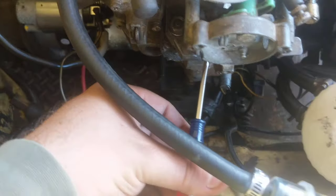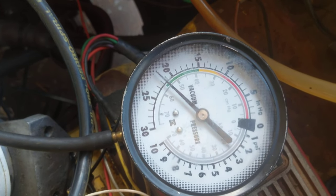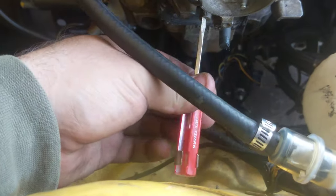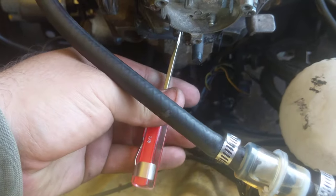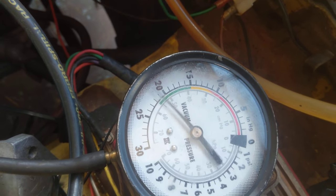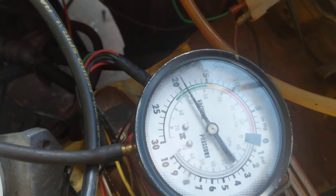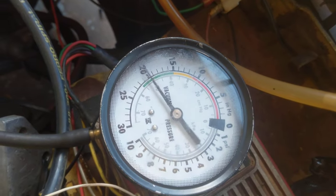So she wants to be about here. Also, this is on the lean side. If I go onto the rich side, I just keep giving it fuel and keep adjusting it. I am going to do exactly the same thing on the rich side. So if I go screw it back in right now, she will stop doing that.